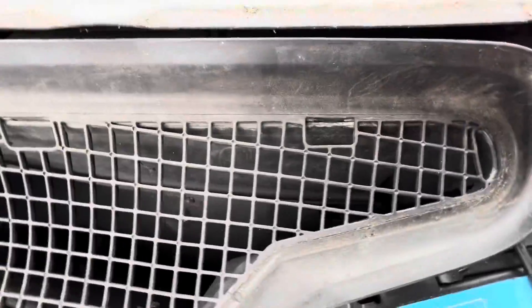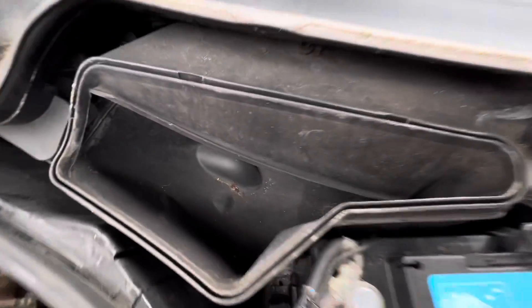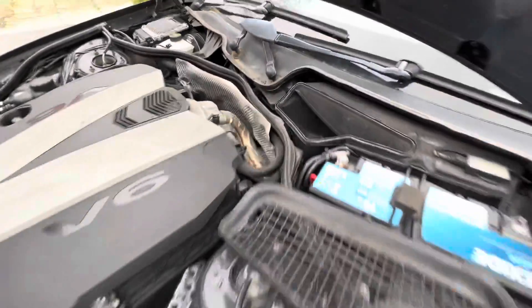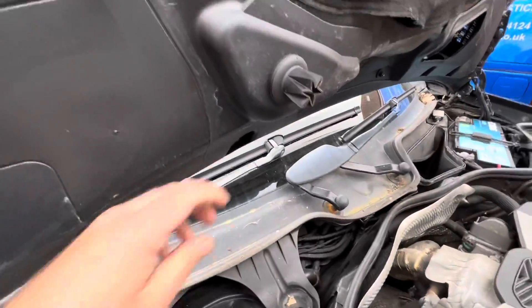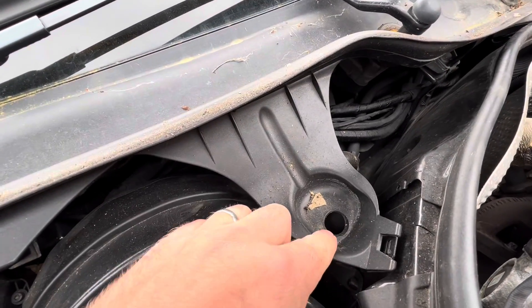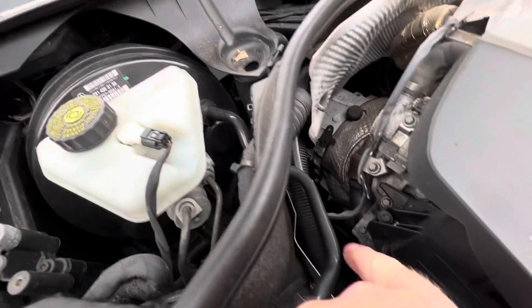If you look also in the bottom of this air intake, right down the bottom, there is another drain down there. If we take the grille off — there we go, that's better — you can see right down there: they were blocked, but I've cleaned all that out. Another place to spot where water drains through from the bonnet area is just up here. These block, so you need to make sure you clean all those out — that then drains into this location here, and that tube goes down and out through the bottom.